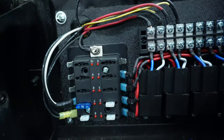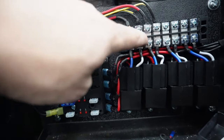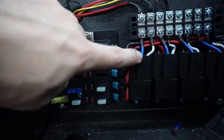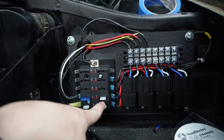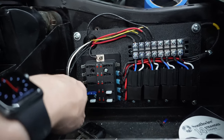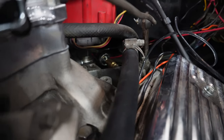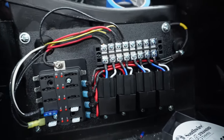Don't jam the wrong size fuses in a bigger hole. But as soon as you hit this switch, the power runs all the way over to the white wire on this relay, activates the breaker in the middle of it, and sends power out through that red wire down to the fan. This other one is the fuel pump — same thing. I've got that button on the inside to turn it on to charge the bowl, and then the other wire runs back to an oil pressure switch. As soon as it sees five pounds, it'll keep the fuel pump on, then it sends power to the relay, which sends power to the fuel pump.